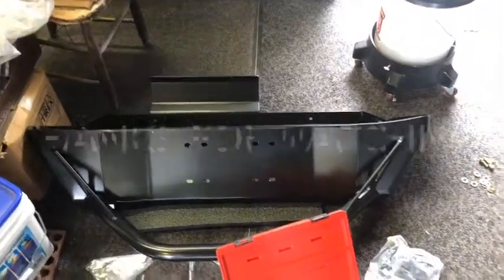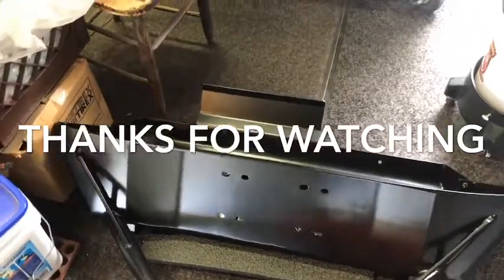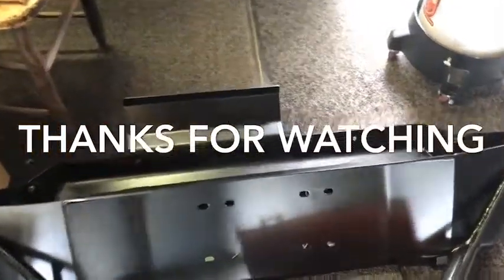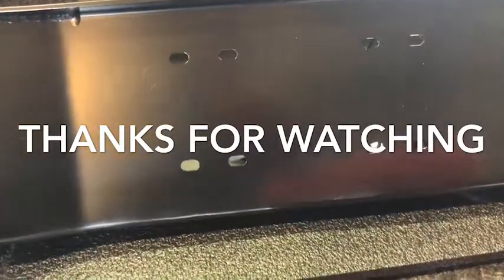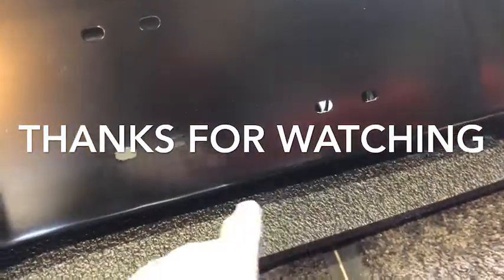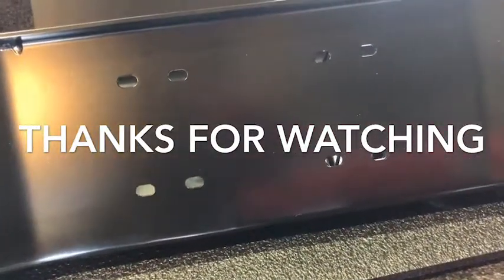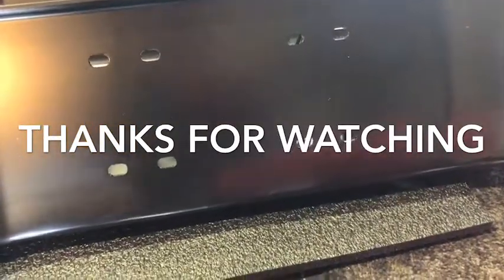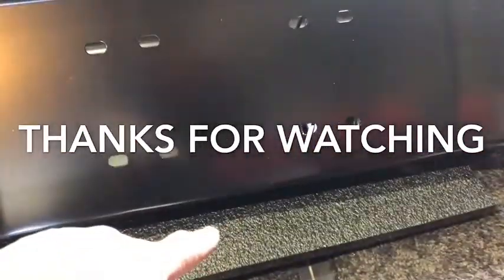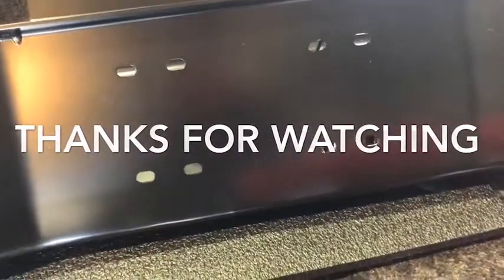Okay, we also have a front bumper that we're going to mount. And every indication said that this was ready to mount a winch on, but it's not. It doesn't come with the fairlead that would be on the front side for your winch cable. So any of you folks that are going to purchase this, be aware that you need to buy a plate that goes on top of this to mount your winch. Just a little tidbit of information.